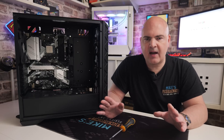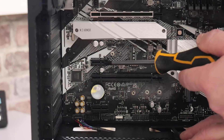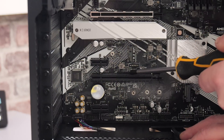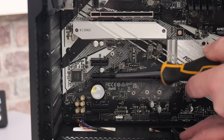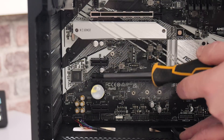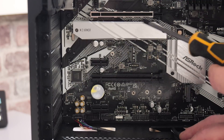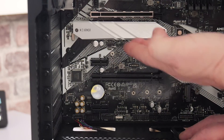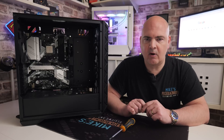So that is pretty much the introduction done. Let's take a look at how to actually go about doing this. The first thing you're going to do is look on your motherboard and look for a spare PCI Express slot which has at least X1 compatibility. The X1 slots are the small ones — they're around about two inches long. You can use the other slots on your motherboard if you wanted to; depending on your motherboard, they may be wired for X1, X4, X8, or even X16, but you only need an X1 slot.